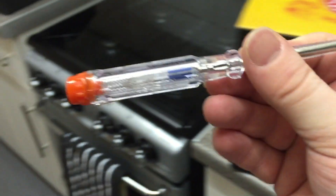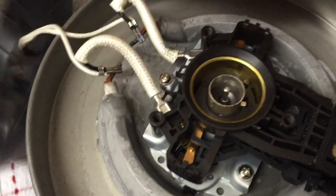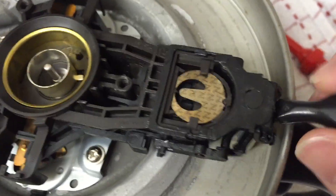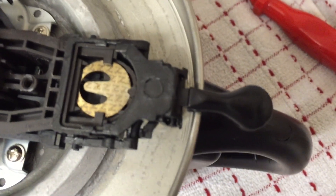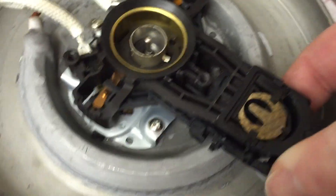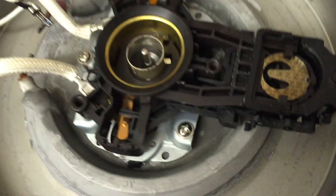And yes, I don't use that for testing the mains before anyone asks. We've got a little neon lamp there. These are the wires that go to the element. We have our switching mechanism which is broken, and what happened is this little bit of plastic came off it when I took it apart. That would normally push down a little plunger thingy here.